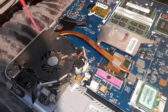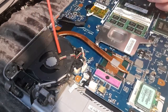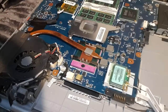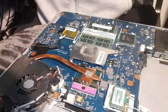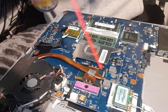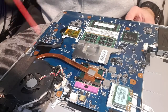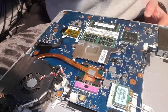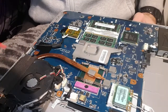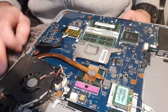Last thing I'm going to do is get my compressed air and spray the fan - there's a lot of dust coming off that. You can also go around the whole motherboard and spray it to make sure there's no dust in there. Do it in short bursts - don't do it all in one go, otherwise it'll come out really cold.